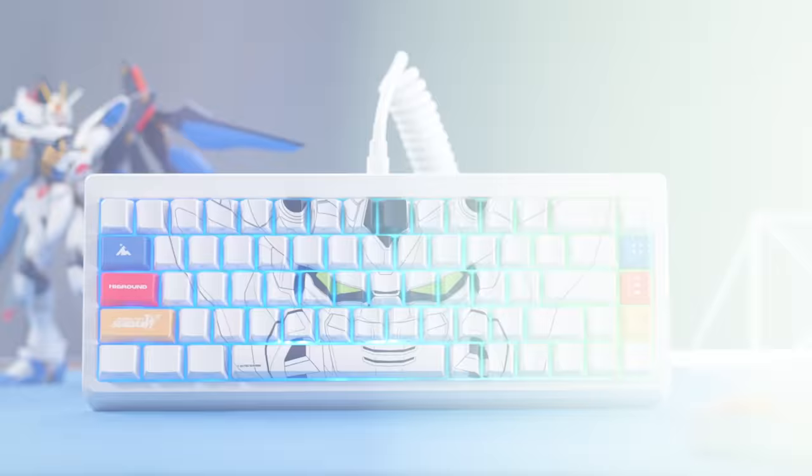It would have done so much better if they were properly lubed. Also, one thing I want to point out is that for a gasket build, it is pretty stiff — one of the advantages of a gasket keyboard is that it's a bit more loose and flexible, but you don't really get that with this keyboard, which is a bummer. I think if they had reversed their internal materials — for their gaskets they're using silicone, but if they had used something like a traditional softer foam material with more give versus the stiffer rubber — it would have provided a more flexible build. Unfortunately, Highground's doing great stuff with visuals and aesthetics, but the overall typing experience does leave a lot to be desired.